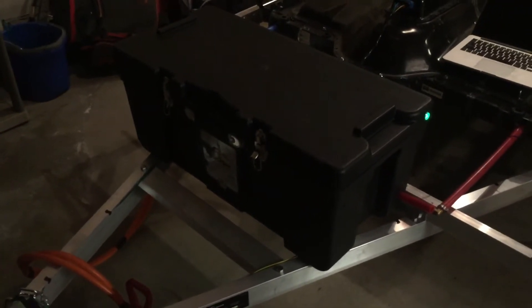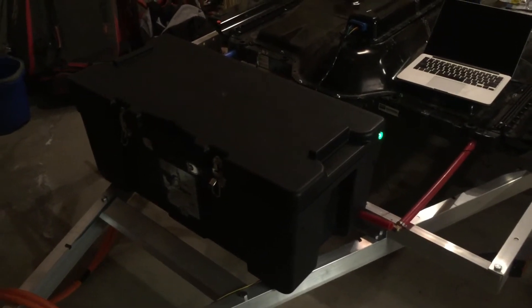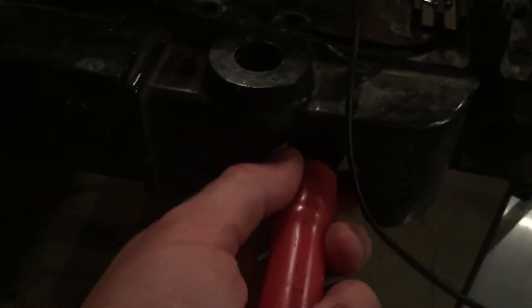I've been working on the heating and cooling system. You'll see the PEX pipe here - that's still a work in progress, I'm still waiting on some parts. I ordered a radiator for cooling and I ordered a Tesla battery heater, so I'm going to tinker with that. What I did here is just heated up that PEX pipe and pushed it right on there - it's on really, really tight. This is 3-quarter-inch PEX. I have a 3-quarter-inch PEX clamp there, but it's not budging - it's too big. I hope it's going to stay put; it seems like it will.